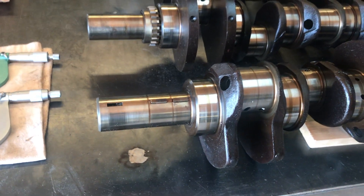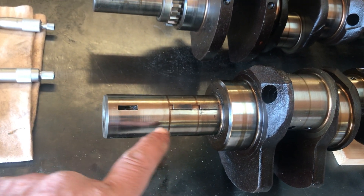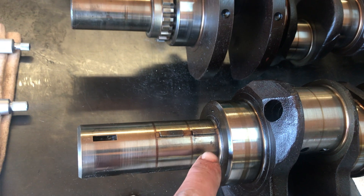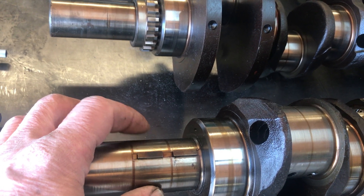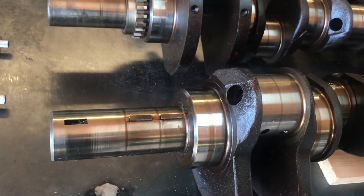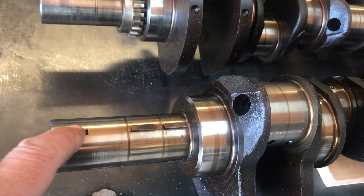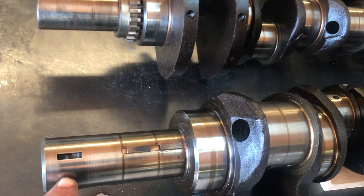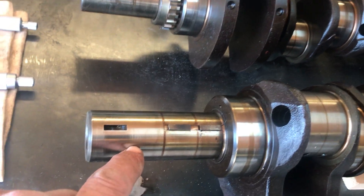One thing I failed to mention earlier: the nose of the crankshaft, or the front end. This is where you've got the drive sprocket for the oil pump, and a collar which seats against the front main seal. Up front we've got the keyway for the harmonic balancer. When you're looking at your crankshaft to determine its condition, check for burrs raised along the edge, see if the key fits in the keyway tightly, and check for any chafing that would indicate the harmonic balancer has been loose.